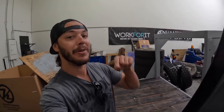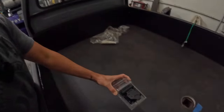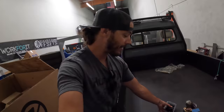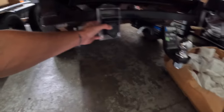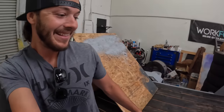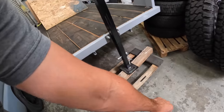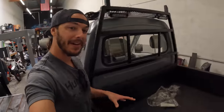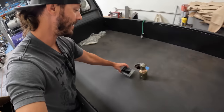The other thing we've got to do is figure out the wiring to get the trailer plug put on the mini truck — we actually have the plug here. My original plan was to make a trap door right here, but this plug sits down and everything's already pre-wired. I might mount this down next to the actual bumper pull hitch and run a wire off the front of the gooseneck, then just plug in kind of like a bumper pull trailer. I know it's not traditional, but I'll have basically double the wiring without cutting a bigger hole in the bed.